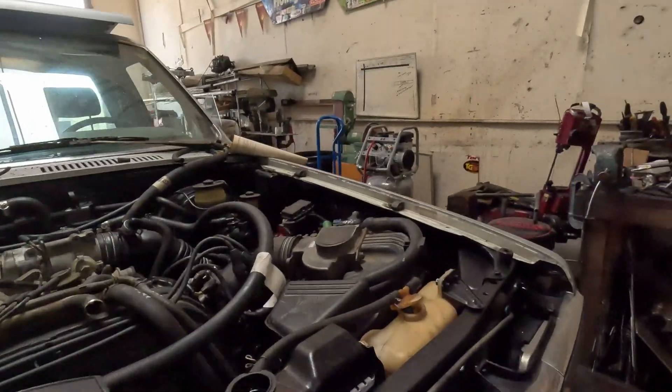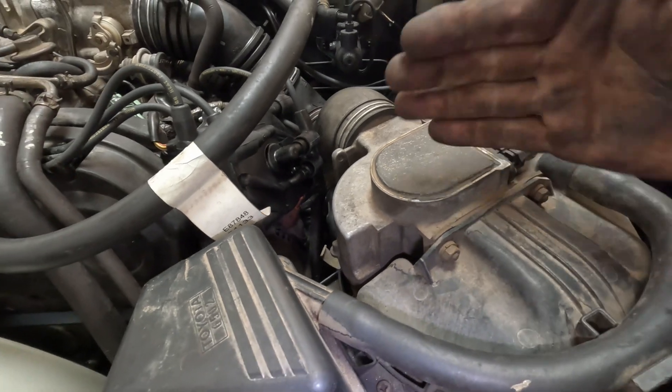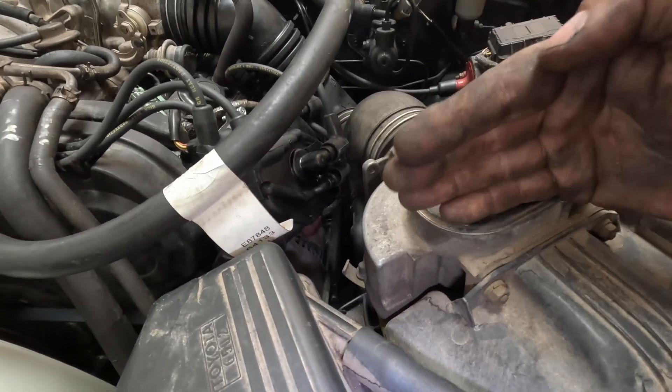In the back of the circuit opening relay there's a single green wire and a white one that's a ground. That green wire comes from the airflow meter. The airflow meter has a flap — a trap door — that has to have airflow going through it to open, which is engine suction as you rotate the starter over. What I usually do is take the end of a ratchet and stuff it up into the airflow meter to open that door, which energizes the circuit and then you can go pierce the blue wire at the relay — it should energize at that point.